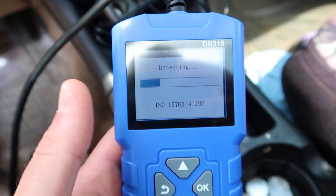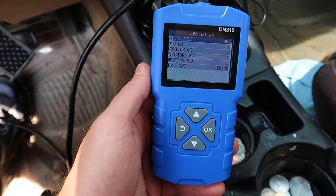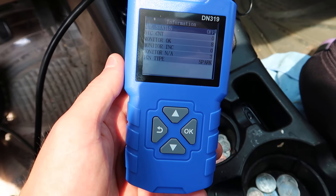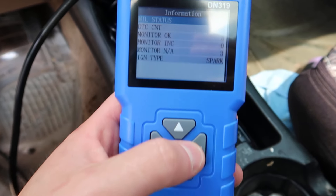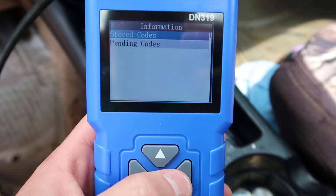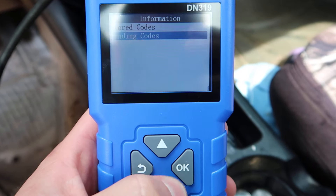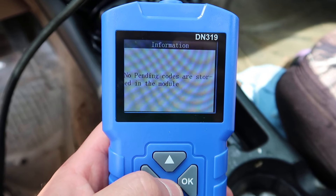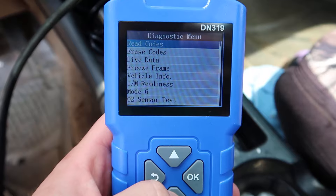The diagnose function goes through the whole system. This isn't just for people with a check engine light - it's also for monitoring your battery or checking for pending codes before inspection. Here it shows options to read codes, view stored codes - we have no codes on this vehicle - and check for pending codes. If something is pending, there's a problem that just hasn't triggered a warning yet. You can also erase codes.